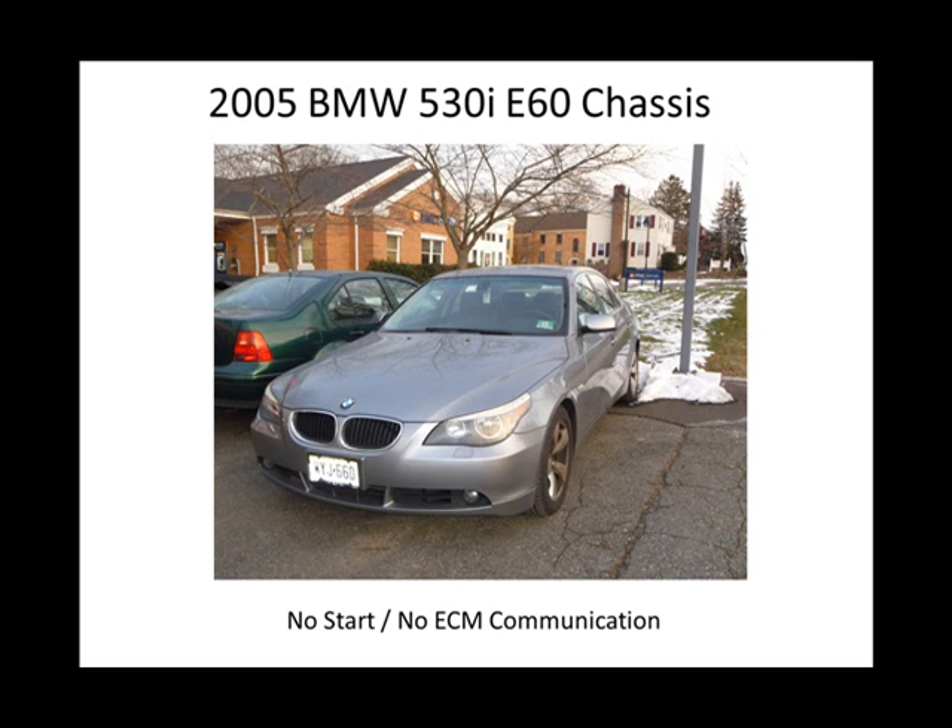You want to make sure that you're checking your powers and grounds. It hasn't changed in many, many years. I used to use the old Simitech system — it was interface technology — and we checked everything at the controller. That's where you want to be, because you're going to cut out all the open circuits. You're checking a fuse here, meanwhile you have a broken wire from the fuse to the processor. So just go right to the horse's mouth, not to the horse's butt.